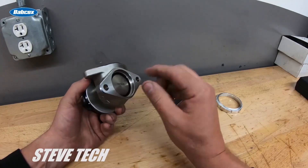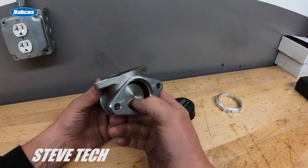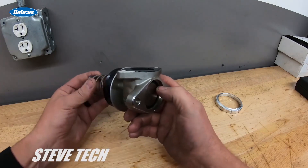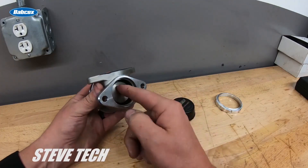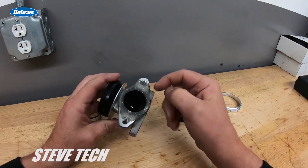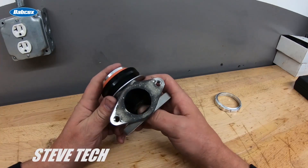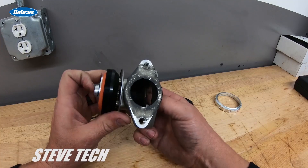The spring is keeping a valve closed. This valve right here goes in and out. It builds up a certain amount of exhaust pressure in the system and we're controlling that pressure and what it bypasses. As soon as it reaches a certain amount of pressure — dictated by the spring — it opens the gate, opens this valve, and the exhaust gas goes past the valve and out your exhaust pipe, out your wastegate pipe. You can tee this wastegate pipe into your main exhaust, or most drag race setups use a separate pipe. It's all sealed up tight — it sees a certain amount of pressure and starts bypassing, which allows the turbocharger to slow down.